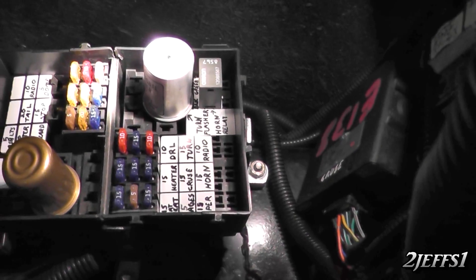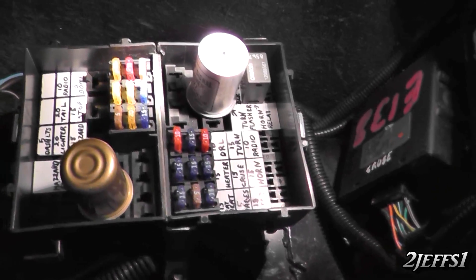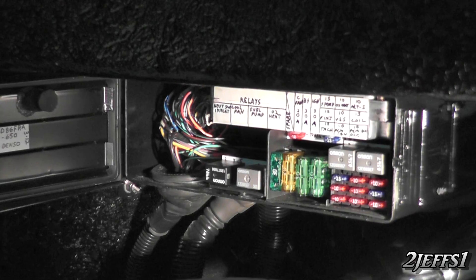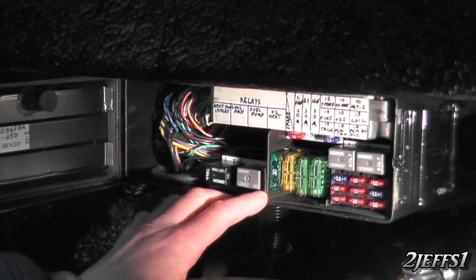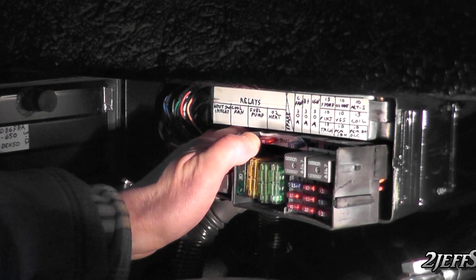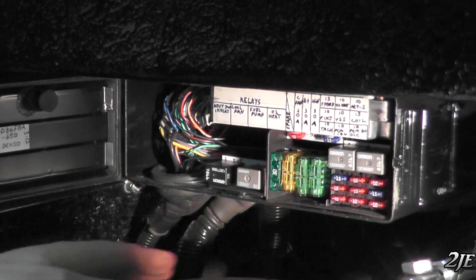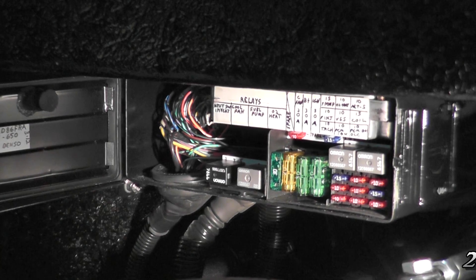This is the one in the dune buggy for the chassis — as you can see it's two boxes joined together so you have plenty of circuits. This is the engine-run fuse box for the dune buggy in an ammo box. There are two of them joined right here with two-sided tape, and I utilized the slides on the fuse box itself, made some little forks so it just slides in there, and the cover actually holds it and keeps it from coming off.